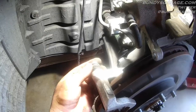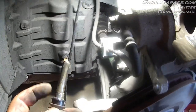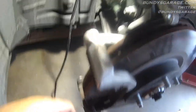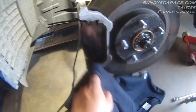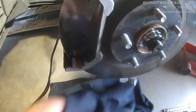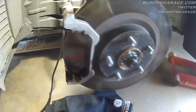You also want to coat the brake caliper pin. This pin actually comes out — you have one on top and one on bottom. You want to put Siliglide on this pin as well, because this helps the caliper slide back and forth when the brake pads engage and release. So let me show that to you right now. You have O'Reilly brake parts cleaner — spray right there, spray on top, take a rag, clean the slide out. You can see all the grease and muck coming out already. Do the same on top and on the backside as well.